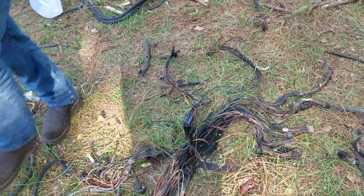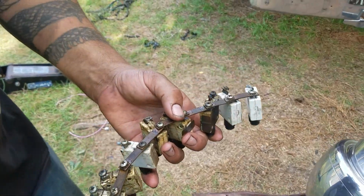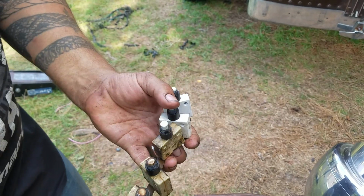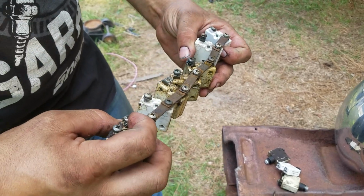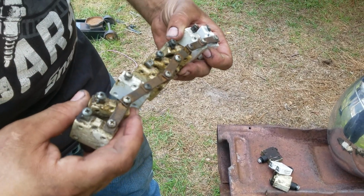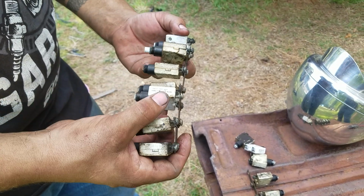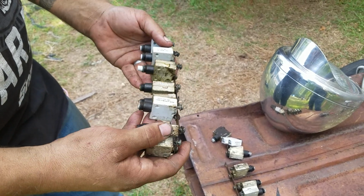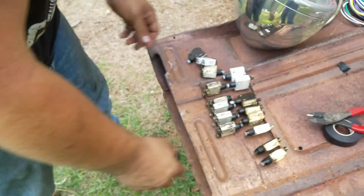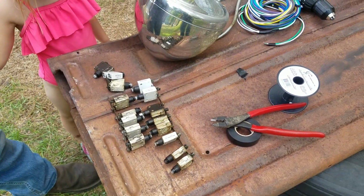And it ran these circuit breakers. The power comes through on the driver's side, and then runs all the way over to the passenger side, and then runs through these circuit breakers here. So everything runs through 14 gauge or bigger, 12, 10, high amperage, high load. Nothing is ground signal. Everything is positive power, and that causes these to wear out quite often. I mean, there's nothing wrong with it, but you're replacing parts all the time, right, or fixing dead wires.